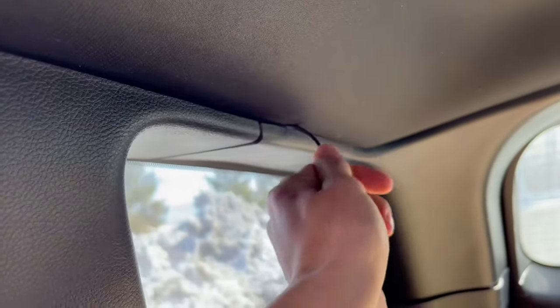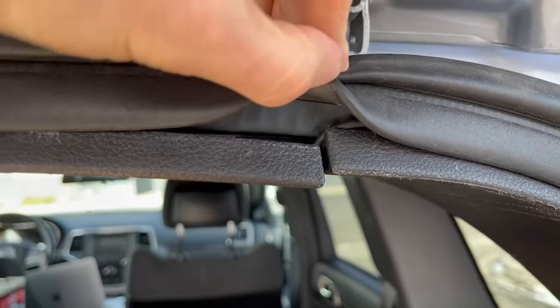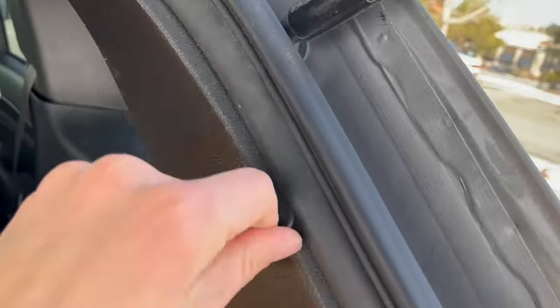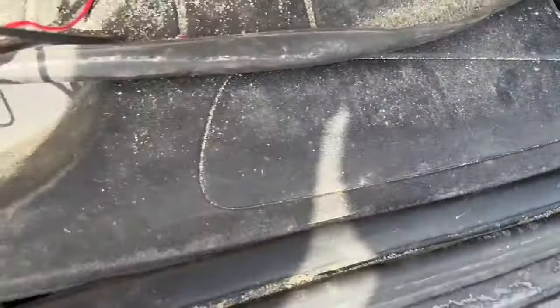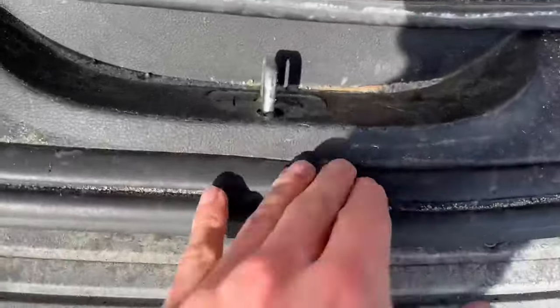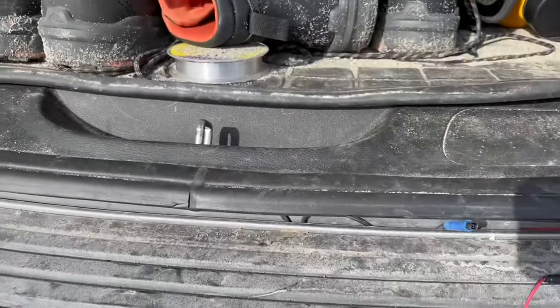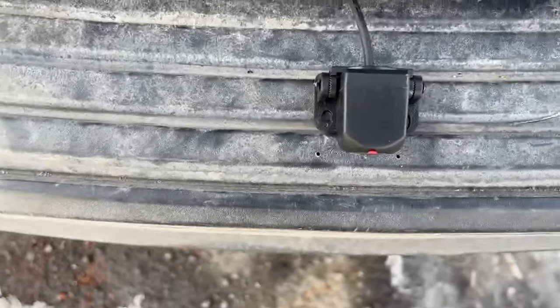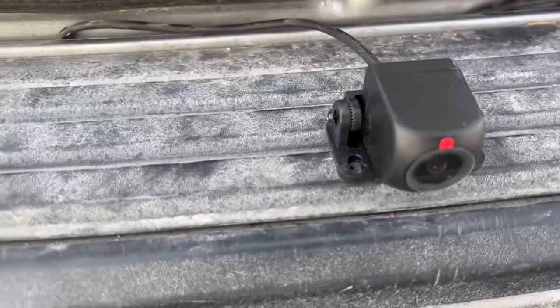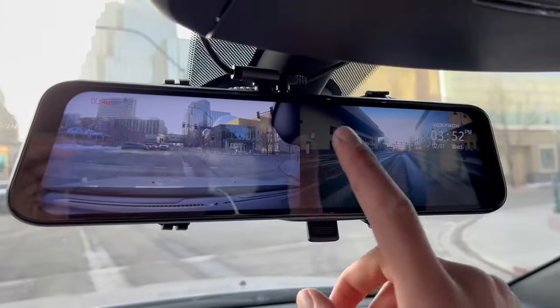Some of that piece is plastic and some of it's the headliner — this was honestly the easiest spot. I could just do it with my fingers the whole way, didn't even need to use the tool. The only little trouble I had was in the back. I kind of had to go through this seam, but since it's black and the plastic piece in my car is black, you can't really see it. I went down in the back and ultimately had to pull up that little rubber piece in the trunk. I tried to tuck the extra wiring in the slot between the rubber and the metal, then drilled a couple of quick holes for the backup camera — very small holes — made sure the trunk actually closed, and boom.